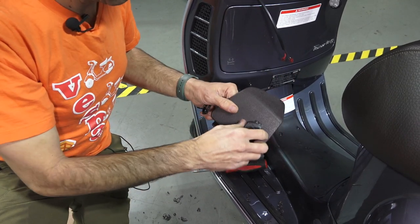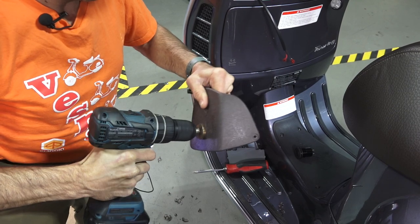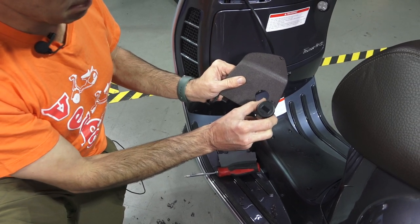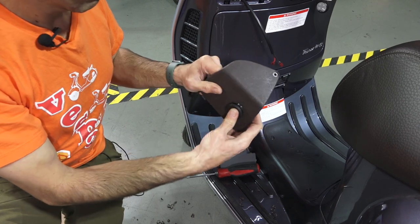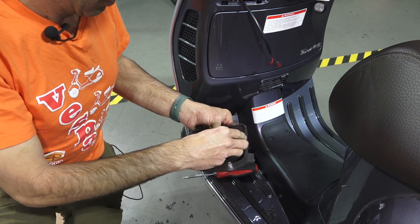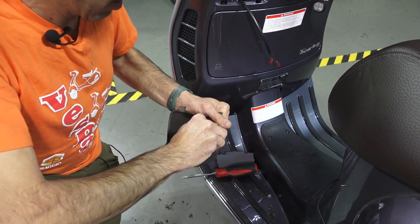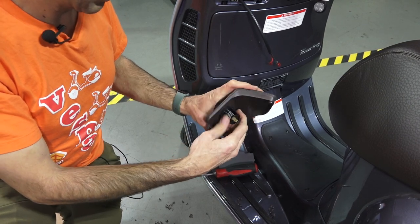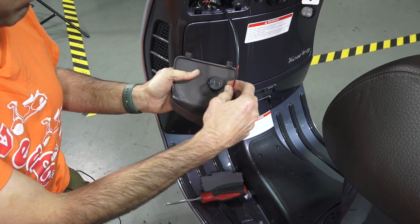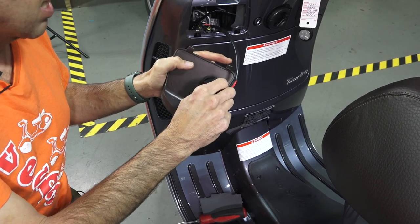Pretty much thread that through — looks like I need to go one more step for the threads. You can pull off any little burrs. Orient the USB plug so the word 'voltmeter' faces up and the little flap goes up, then get it in there from the back side and spin it. All you've got to do is hand tight — just about as tight as you can get it by hand. Don't put a wrench on that. The body of this USB jack is all made of anodized aluminum. Then make the two connections: the brass-colored connection is your positive — there's a little plus near it — so push the quick connects right onto it. The silver connection, which has a minus next to it, is your black connection.